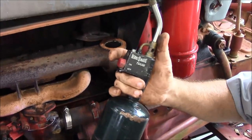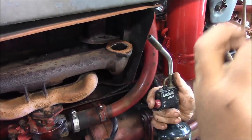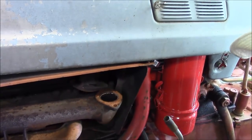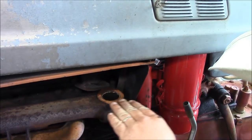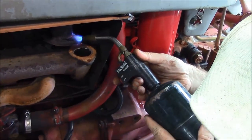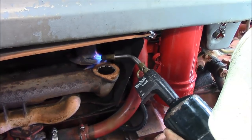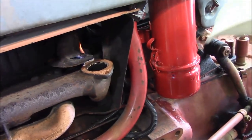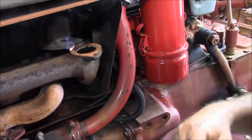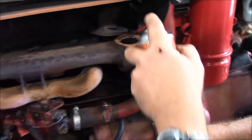What we're going to do is apply just a little bit of heat with one of these Bernzomatic torches. I don't want to get the fire axe out yet — we'll do a hot-cold cycle, hit it with some Knocker Loose, and let it contract so hopefully it'll suck the penetrant in there. If this doesn't get it, we'll take the grinder in and cut this off all the way through. The reason I don't want that to be my first choice is I don't want to gouge up the sealing surface by accident — it's a pretty tight fit. So let's try a little heat first.